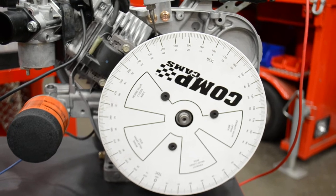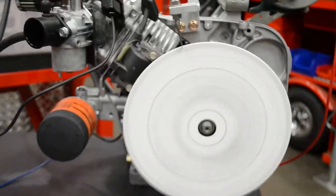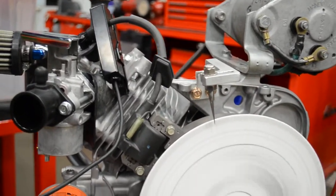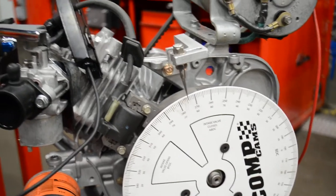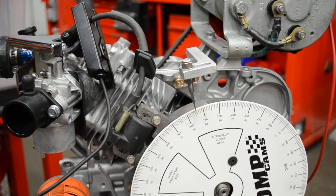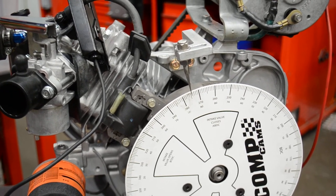Here's how we do it. We've got an automotive timing light attached here and we'll just run this thing. This one's set at 30 degrees — that's kind of where we start on the dyno. This particular engine is one of the 325cc big bore 290s with a little bit of lumpy cam in it and no counterbalance, so it's not too happy just bolted to a simple bench like this.